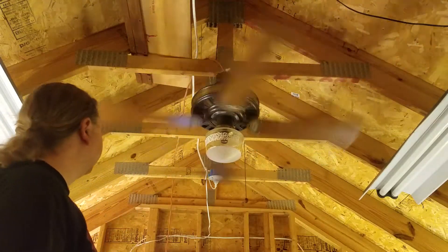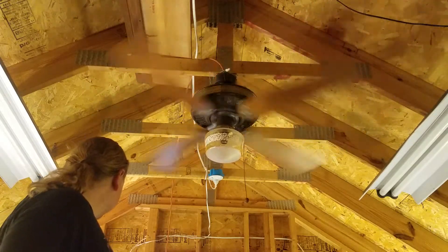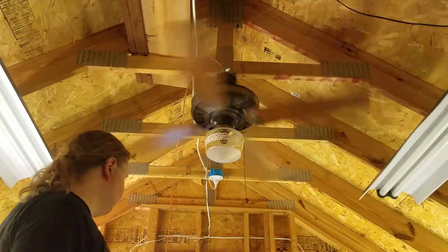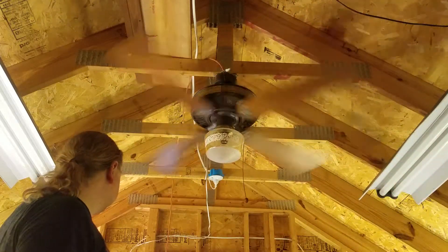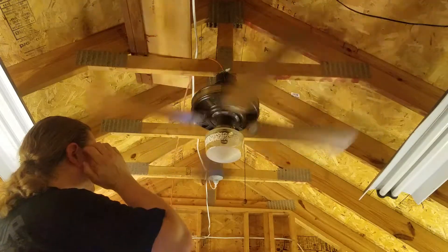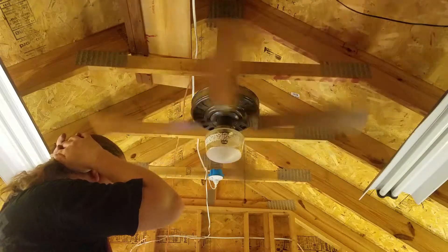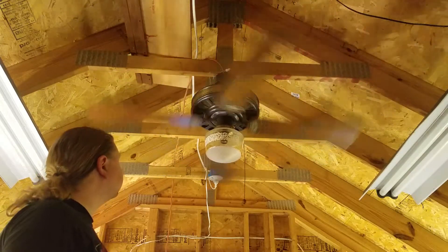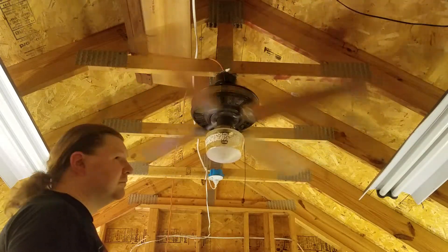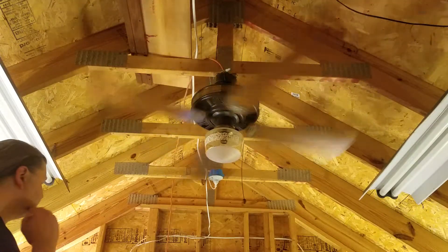A KB55. The Lasko version used a skeletal motor. What's a skeletal motor? A skeletal motor is like a spinner motor that's not in a casing — the windings are exposed, and the rotor is cast, but it's not in a casing. I don't know why we consider them to be better than spinner motors, because they're literally a spinner motor with less material. But they almost always tend to be good motors, whereas not all spinner motors are good motors, so maybe that's why.